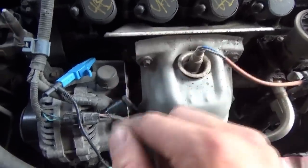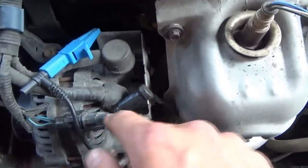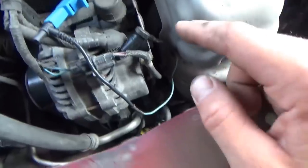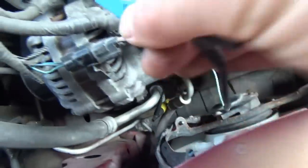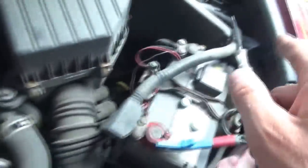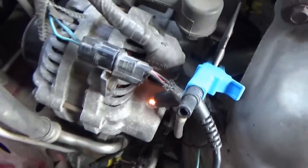We're not looking at controls or the relay — just at this clutch. Following the wires, this blue and red comes in, and then this red wire goes all the way to the clutch and it's grounded down there. So there's no continuity. How do we check wiring integrity all the way through? The quickest way: instead of using an ohmmeter, hook up another test light to ground as close to the clutch as you can get. Now if the wiring is good all the way, the current should flow through both test lights, so they should both be dim. Sure enough — dim bulb there, dim bulb there.